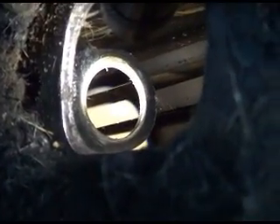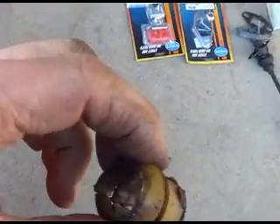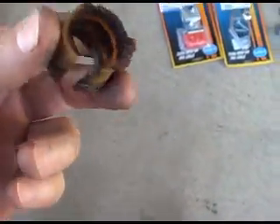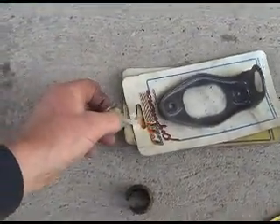I've got my shift rod forward and I'm looking at the hole — it is round. Sometimes when the plastic's been missing so long it starts getting out of round, and that's what the repair plate is for. Here's the old one. The capture ring doesn't look entirely bad but I think it was good that we got in here. We'll get it cleaned up and put a new one in. This is pretty soft — the lubricant seems to sometimes attack this plastic nylon. I'm slowly, one piece at a time, converting this car over to a Chinese Volkswagen.